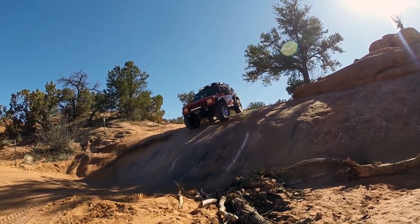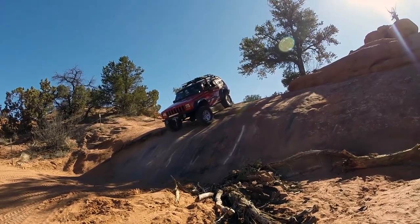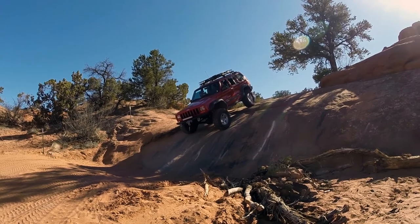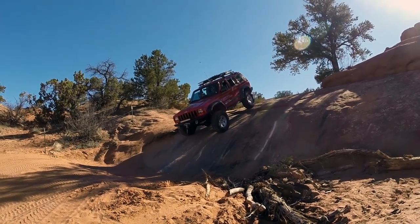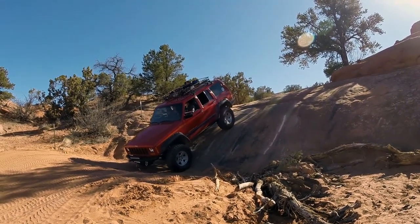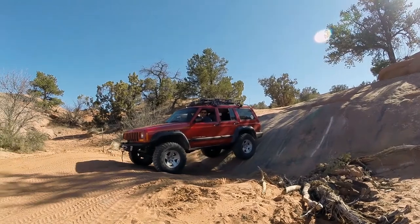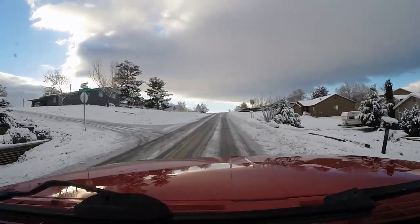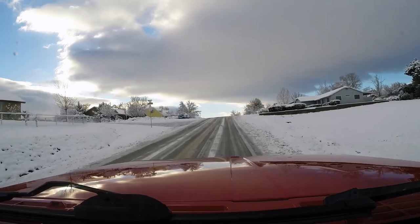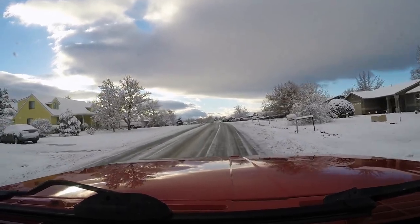The problems I was having previously: anything over 85 or 90 degrees outside running the AC, I was running hot — hitting 230°F, and I'd have to shut the AC off. The winch isn't covering airflow; it's buried in the bumper, so it's not a blocking issue. In stop-and-go traffic it would creep up to 225 and I'd have to shut it off. Frequently I'd hit 235 degrees, which is not good — confirmed using both the gauge and an OBD-II scanner. It was really bugging me, trying to figure out what I could do to get this thing to run cooler and not stare at the temp gauge every time I drove it.